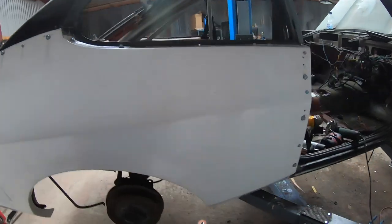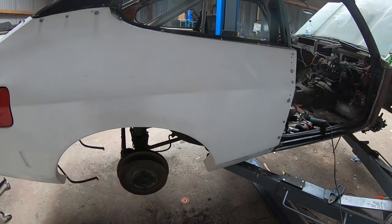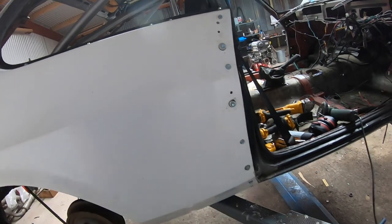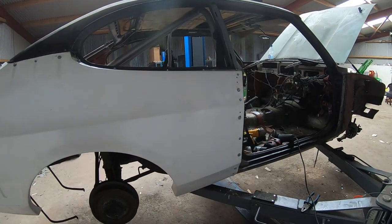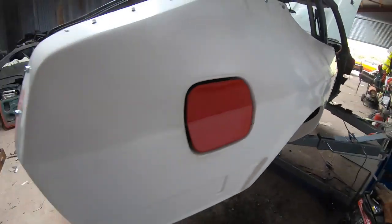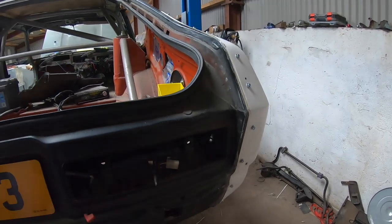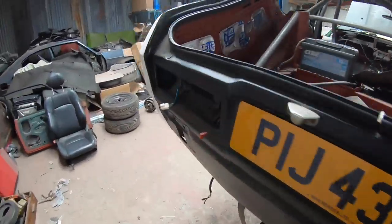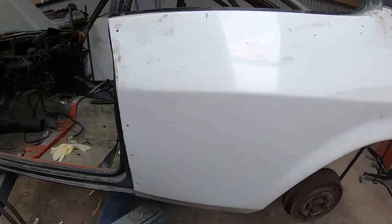One kit mounted and very happy with that. My problem near the end was that these tech screws have been in and out so many times during trial fitting that the threads are starting to get weak — hence why there's like a pin cushion in some places — but that'll all fill over. I'll be able to get at that from the back, put a bit of metal in behind it, and fill over the top. That will probably do me for this episode. The first side, now that all the screws are out, is solid as a rock — you couldn't pull it off if you wanted to.